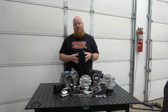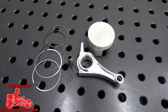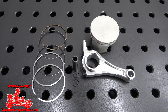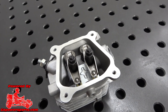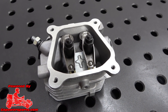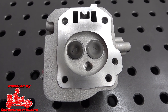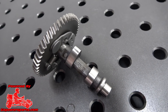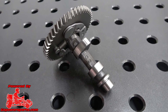Then we're going to get on the bench and make some power. This Tillotson 225cc kit comes with a forged flat top piston that is two millimeters bigger than your standard Predator's piston, also with a billet rod with insert bearings. For the head, we have a large port 196R head that will flow a little bit better than a stock head, with 27mm intake and 25mm exhaust valves. This head also comes with upgraded valve springs right out of the box. For our cam, we have a 265 lift cam, one of my favorite cams offered from Go Power Sports.